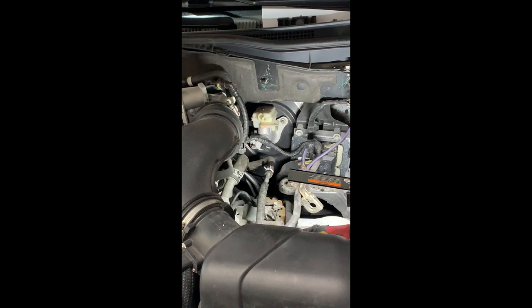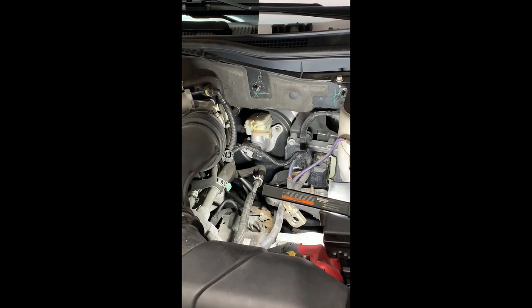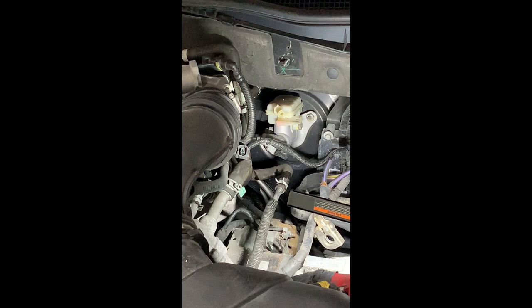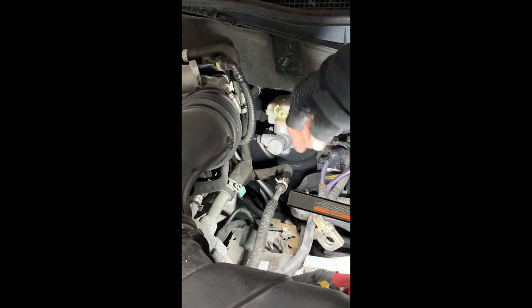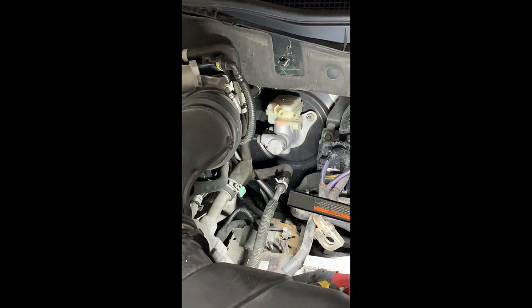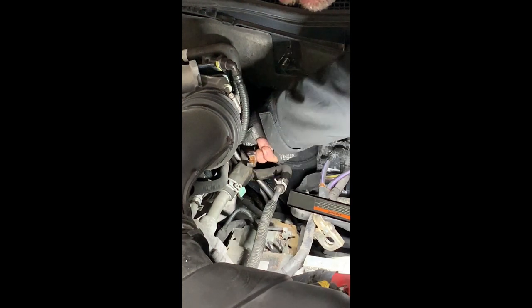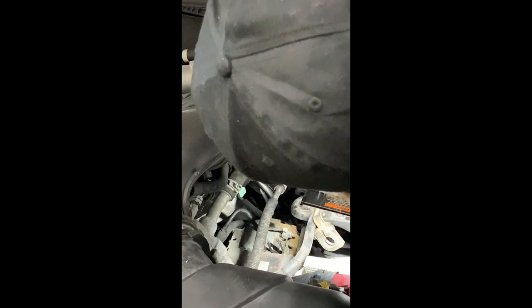This actually gives us a better visual for the whole job. You can see, ladies and gentlemen, we have a master cylinder. Let me get those lines out of there — using line wrenches. Those look like 13s — and yes, they are 13s. You can loosen them with the line wrench and then go to a regular wrench.